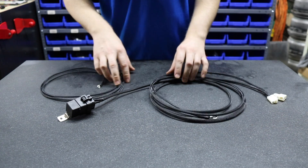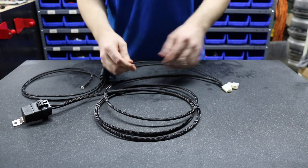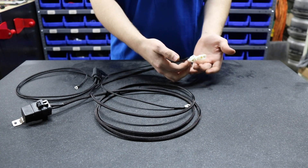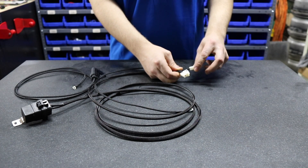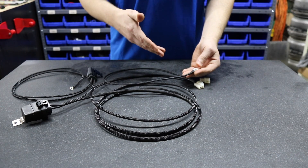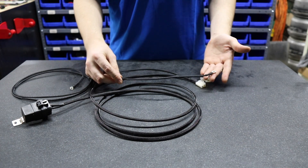Running through, we have the full body of the harness. This will fit 2-door and 4-door applications — it's plenty long, and if you have any extra, you can wrap it up underneath the dash where this centralizes. It runs all the way down to our plug-and-play connectors. What we're doing during installation is unplugging the stock harness and patching our harness in, with power and signal wires running all the way through. This connector picks up our stock fuel pump signals and allows us to use our new power and ground signals, with a ground wire long enough to run outside your fuel pump cover and bolt up to most rear seat mounts where the 10-millimeter stud is on the chassis.